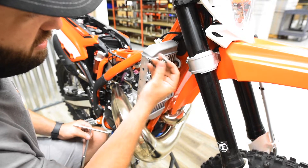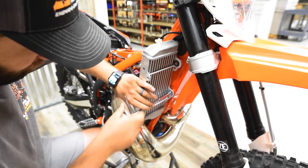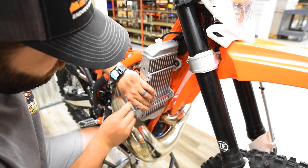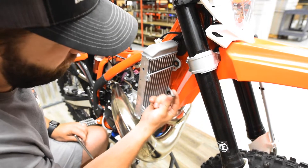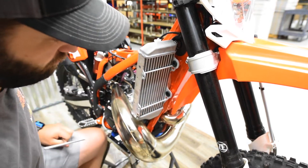There's going to be a washer with each bolt — you're going to want to keep these together. Same with the bottom bolt; make sure you keep that washer on. Now your radiator is loose.